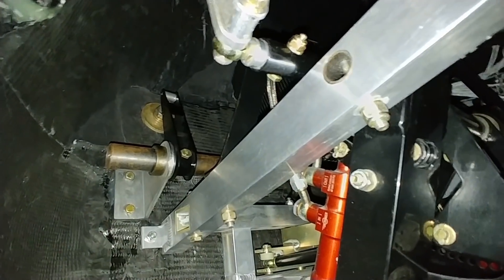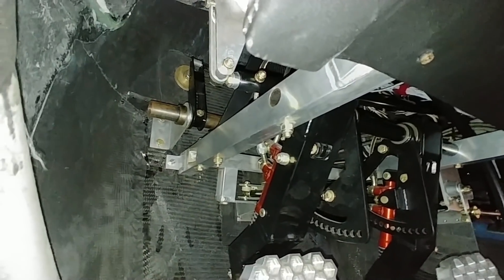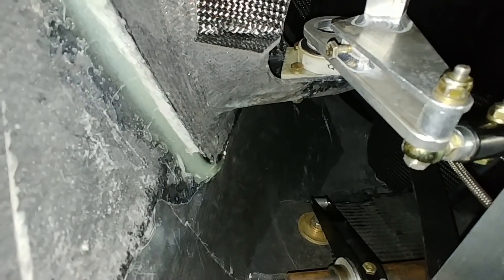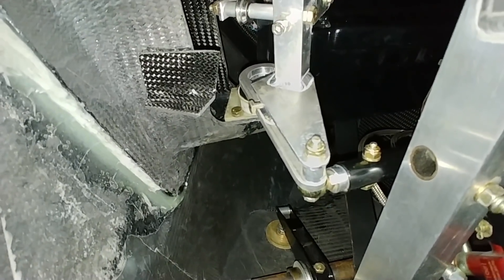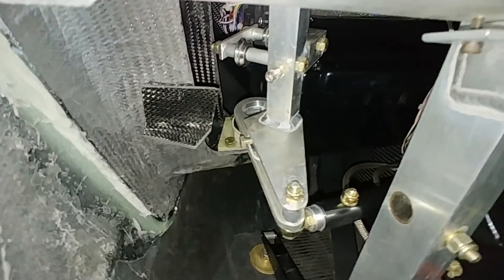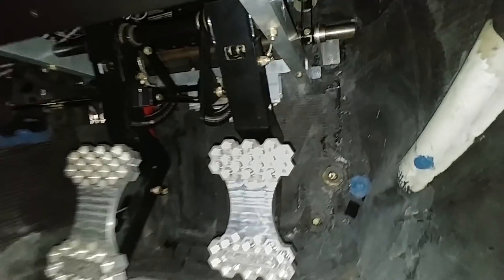I had to bolt the aileron connecting rods on the back side of these brackets because my offset ended up being a little bit further aft in the ship than I thought. But it doesn't really matter because it's still in double shear there with the two brackets. I've put a solid aluminum spacer in there, just drilled through, and it's all bolted up nice and tight so it's not going anywhere. I've also gone and bonded in that little bracket there for the stopper — where that bolt is going to go up and touch it — because the throw wasn't enough to reach all the way to the existing bracket. I just cut those little bits out of some scrap L-bracket carbon fiber and bonded them on with epoxy.